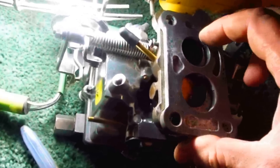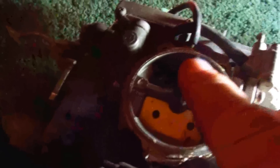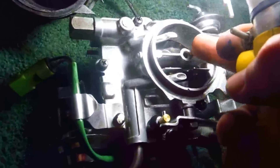These are the simple modifications to bolt up the carburetor. On the air cleaner, you've got to put a couple little dents on the bottom to make it sit on top of the Toyota carb, because parts up here will hit. I'll also need to find another bolt for the air cleaner stud — I'm going to get a bolt, thread it in with some Loctite and use the spacer, so I can still use the stock air cleaner.